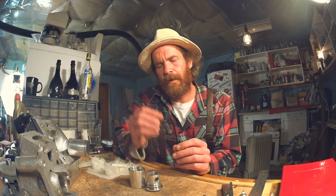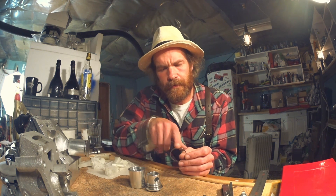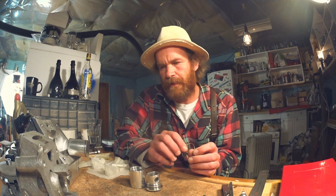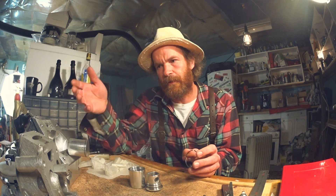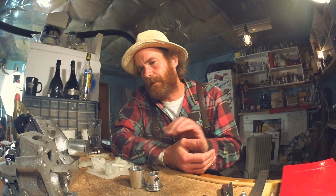Welcome back. Last time I re-ground another ring for this piston. The previous ring had developed a really large ring gap. We'll grind that peg slot and assemble and do a compression test and see if there's any difference to what it was last time I did a compression test.